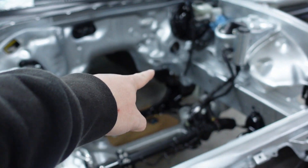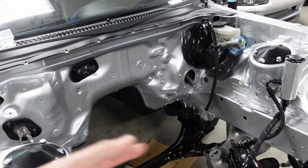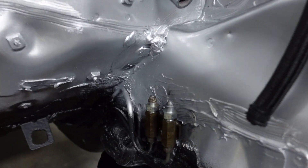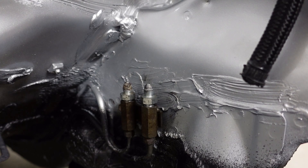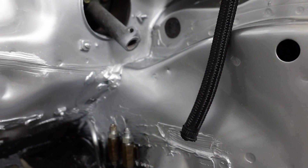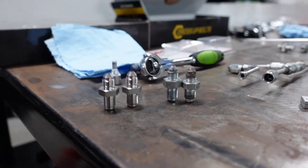These old fittings went to the actual brakes themselves. I want to replace the two adapters I had down there — they look a little crusty. Now is the time to do it. You don't like messing with brakes, re-bleeding sucks, getting brake fluid out sucks, so while I have everything apart, replace everything now. I'm going to pull those out, get some blue towels under there so it doesn't leak any brake fluid, since I assume there's fluid up almost to the top.